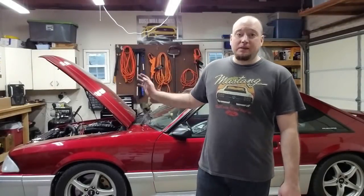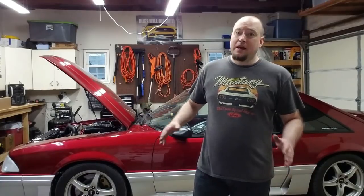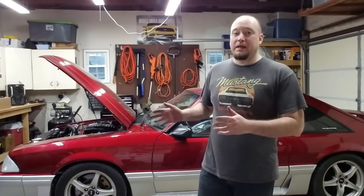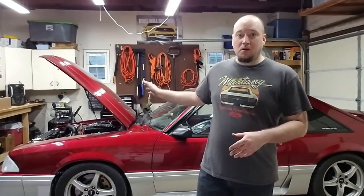To wrap it up, I went ahead and let the car fully warm up and then let it cool down a little bit to check for leaks. Everything looks completely dry and I'm really happy about that — crisis averted. I didn't have to worry about possibly burning down my car because I got curious about that drain line, and sure enough there was a tear in it. It really does not take much effort to pull the turbo off — it literally took me about a half hour. Removing the alternator is definitely a big help for accessing the bolts, and it should take no more than about ten minutes. Make sure you have the correct Allen head socket — it makes life so much easier than dealing with a little 90-degree Allen wrench.